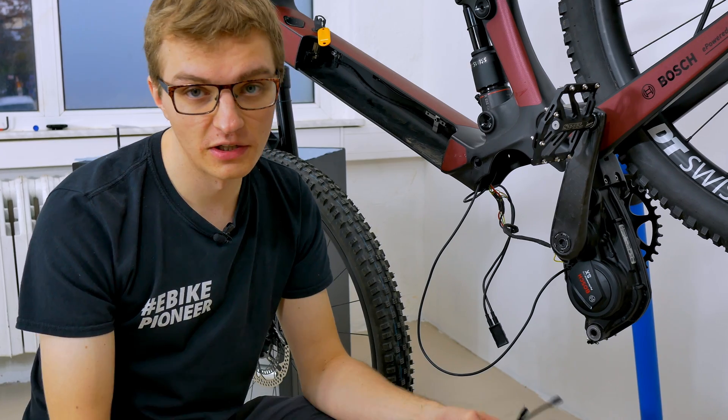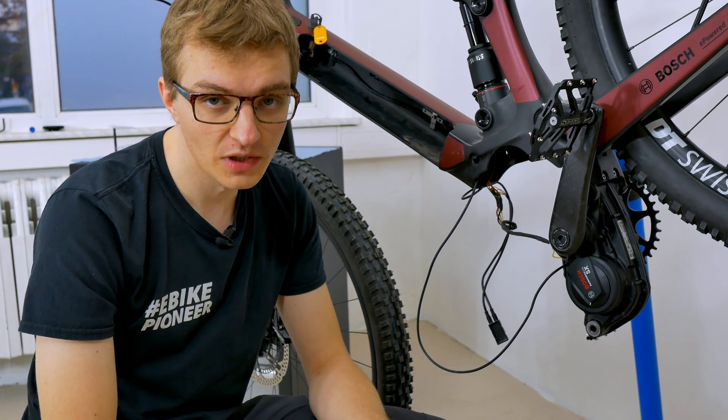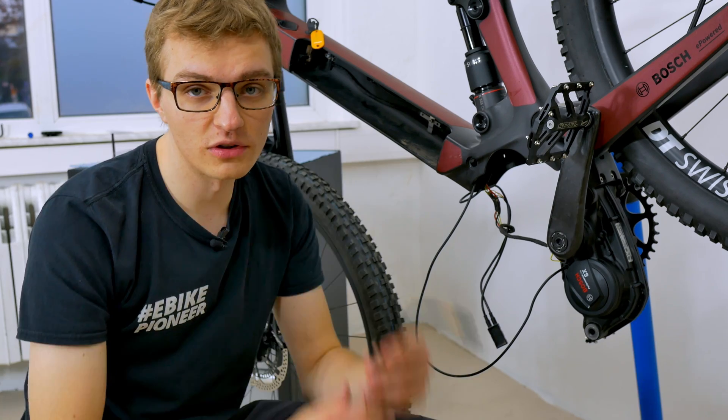I would like to add that the high power port runs at 12 volts and 1 ampere, and at the maximum peak, 3.5 amperes are possible for a maximum of four seconds — which this HPP can deliver to your e-bike. This can also be used for headlights, for example, and the possibilities are endless.